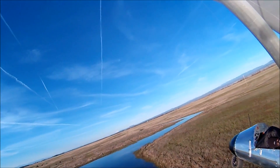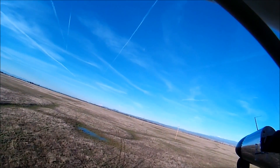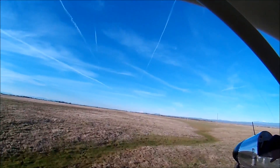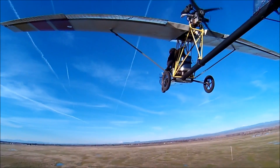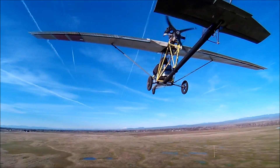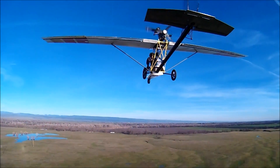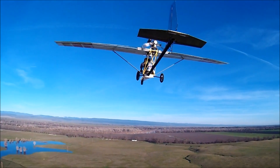You see how smooth the video is — it's really pretty usable stuff. The camera is now cinched up against the wing with about six to eight inches of monofilament line holding it off the carabiner. Those little zip ties are just holding it off the fabric and the slipstream is holding it in place. If I was to slow down it would drop. I'm going to pull up here and then use the drill motor to release the camera, extending the line backwards. I like that effect of the airplane kind of pulling away. But when the camera hits the end of the line and stops, you see that bobbing up and down. I think by adding a third line on that harness which connects to the camera down low, I can help minimize that bobbing. Every time it stops and starts you get that up and down motion — it's less stable in that axis than it is in the pitch and roll axis right now.